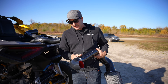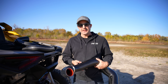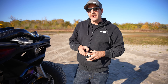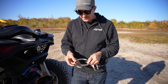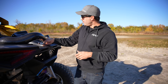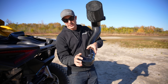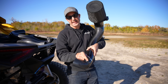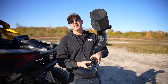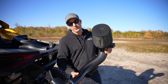We've got stainless worm gear clamps, and these aren't just any typical worm gear clamp — they have a stainless ring on the inside that provides very equal distribution of pressure across the silicone, with a heavy-duty worm gear clamp inside of that. Moving on, you've got your silicone coupler that goes to the turbo to isolate it. On these intakes you don't have to run a catch can, but we highly recommend it — you should be running a catch can to compound those gains.